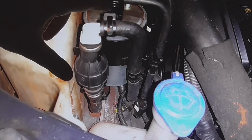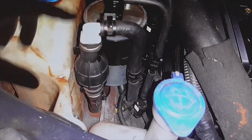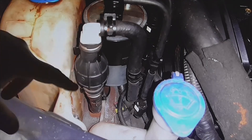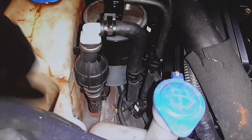Mainly vehicles carrying VP44 pumps — no comments on those. They install this temporarily; some have been doing it for several years. Before starting the vehicle, because they know it won't start since the system has taken in air, they prime until it stays hard, then turn the key and the vehicle usually starts. That's where it is usually installed.